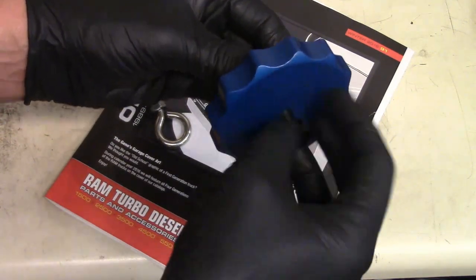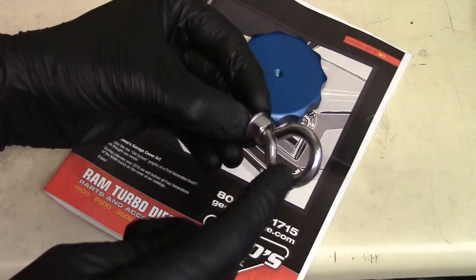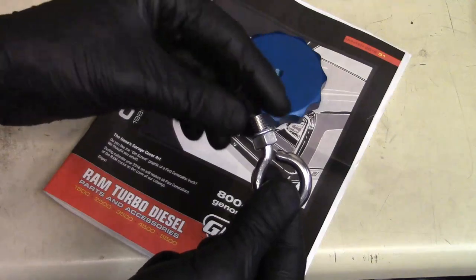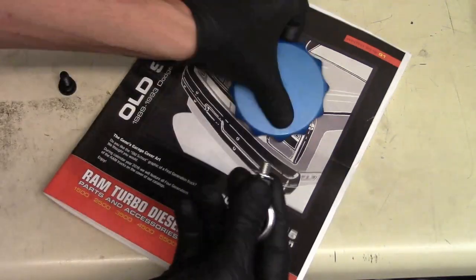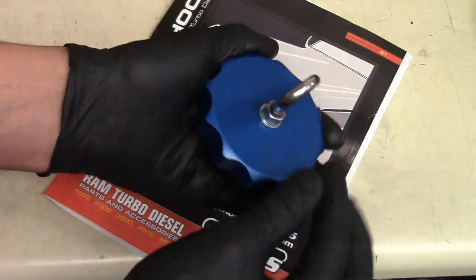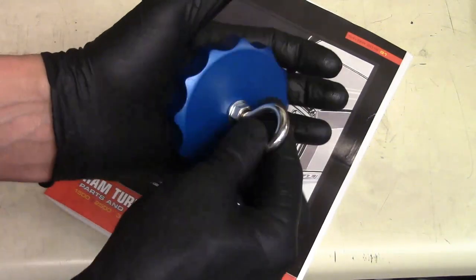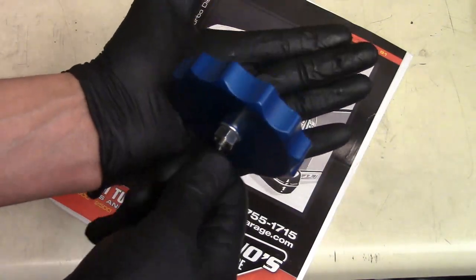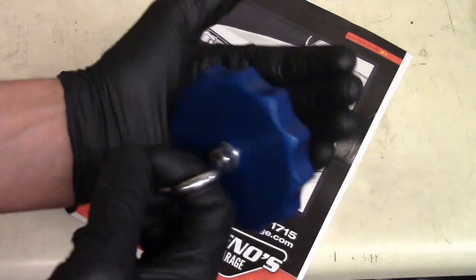What I did was I walked to my local Lowe's with this piece right here, and what I came out with after going up and down all the aisles was an eyelet. The shaft was probably about another inch and a half longer, so I went ahead and cut it off to where I had probably about half an inch of threads. It came with the nut, all I did was add a washer. And you get the tool — it's the same threads. Now I've got something more I can work with. I can use the eyelet to help tighten down the cap on the filter, use the eyelet to help loosen it and take it off the filter. And while the oil filter's in there, I've got something to put my finger on, grasp it, and actually pull the filter out. So I've got a lot I can work with — mainly this right here is what helps me get it in and out easier. A slight modification, nothing major, probably less than $2.